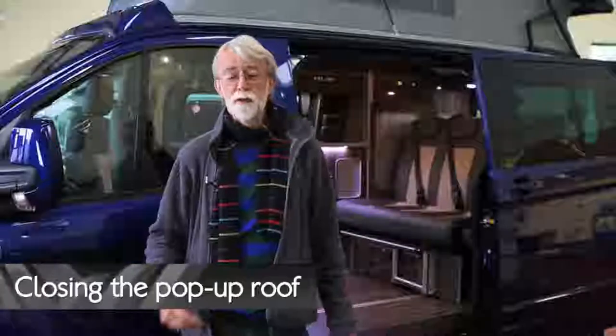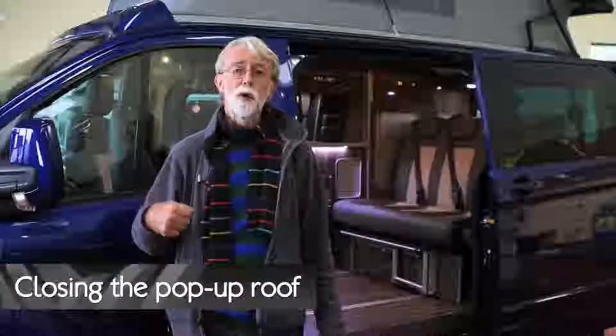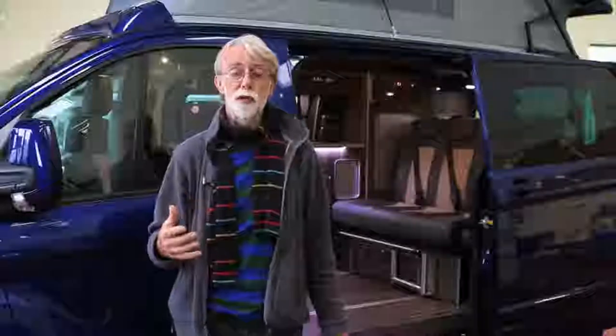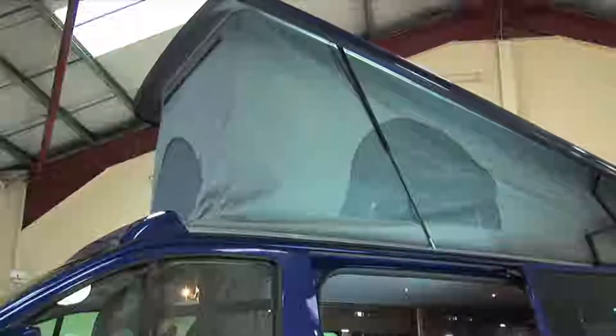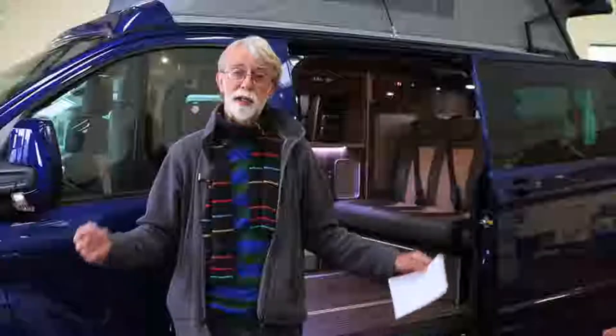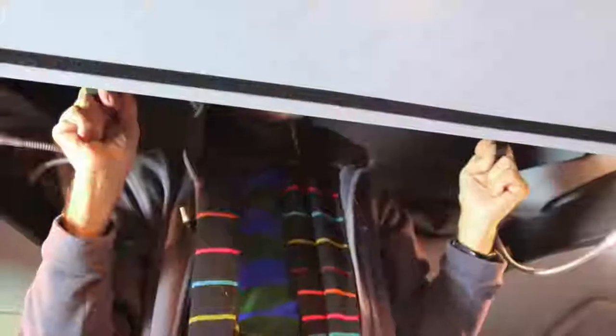Points to remember when you're closing the roof. First, unclip and unroll the sound deadening panel and let it hang down. Make sure there's a door open to release the air pressure as the roof comes down, to stop the canvas billowing. Make sure all the windows are fully zipped closed before you attempt to close the roof. Pull the bed down and make sure there's no loose bedding on it. Grip the two straps, pull the roof down to about 20 centimetres from fully closed. Make sure the canvas isn't trapped in the edge of the roof, and that the catches are clear of the canvas. Pull the roof fully down. Attach the hooks and turn the buckles through 180 degrees to make sure the roof is fully clamped down. Finally, attach the safety straps.